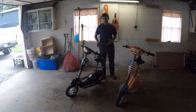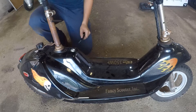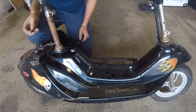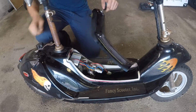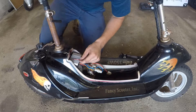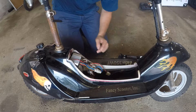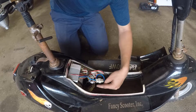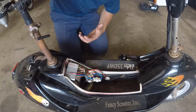Now that we're back from the store, let's go ahead and get the batteries in as well as the fuse, and then I'll just copy what I did for the other one. As you've seen in the last video — our problem solved video — we did find out that the fuse was bad. We checked the cap, but it's actually the fuse housing that's bad. What I want to do today is get this fuse housing out of here. We're going to leave the original fuse housing in there but bring the new fuse down here — that's what we just got at the store. I think we can put it down under the motor, which would keep it out of the way of the chain and the circuit will still be protected.